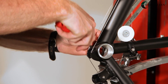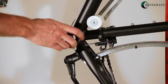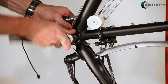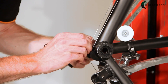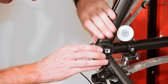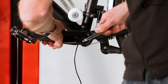In order to avoid damage to the cable outer casing, carefully deburr the drilling point with a file or a countersink tool. Lightly screw the left cover of the inner bearing by hand into the screw thread, then use a torque wrench to tighten it, paying attention to the specifications provided by the manufacturer. From the other side, push the sensor cable through the hole you just drilled and insert the inner bearing, then screw on tightly.